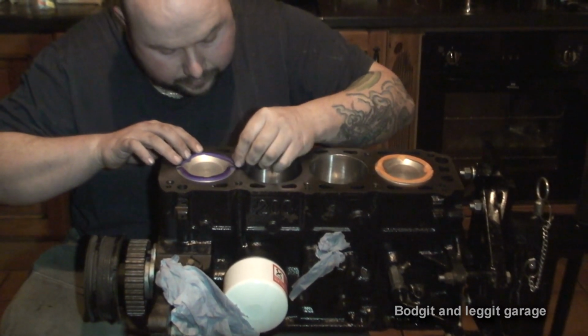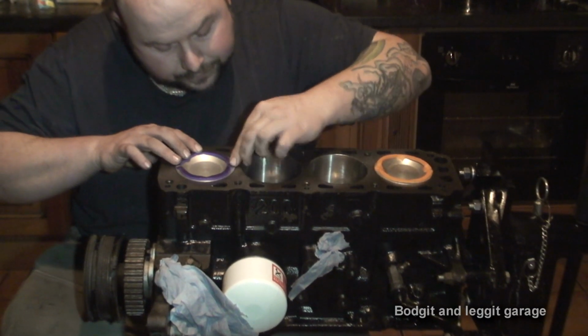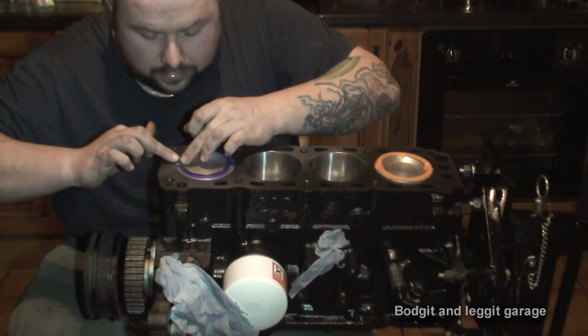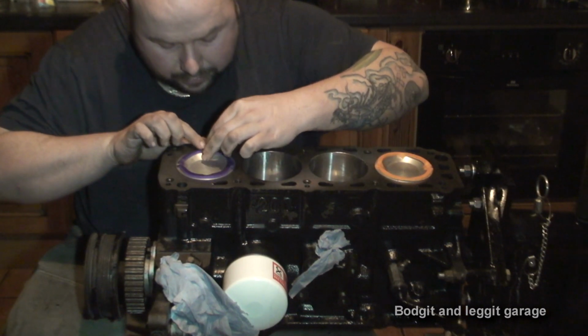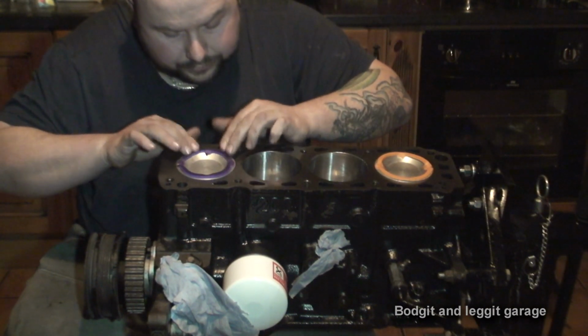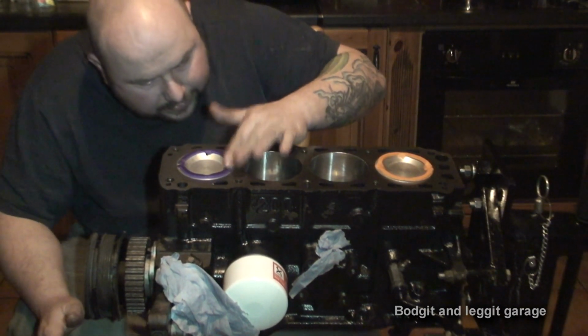So again, just bend the plasticine round. Squeeze the ends out. I'm squeezing the ends here because I know at these ends, there's nowhere the pistons can actually hit, so I know I'm not going to affect anything. And just push down the middle to give it some sort of gap. Now just push down to make sure it's actually sticking.